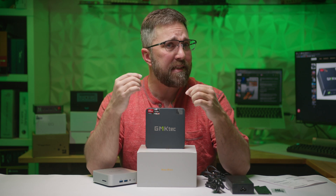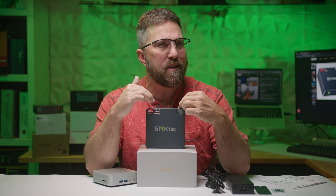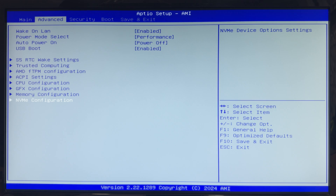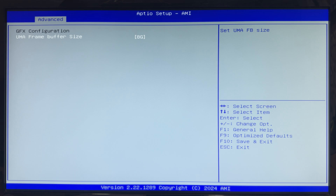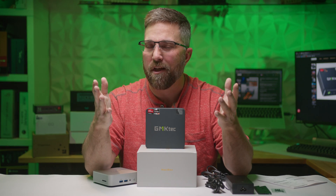If the PC has heat and fan noise problems, one way to fix it is to nerf the CPU, sacrificing performance for efficiency. Before the update, I took a minute to check the BIOS. It's pretty limited apart from setting the default power profile and designating the dedicated graphics memory — there isn't much tuning you can do here. This wasn't changed after the BIOS update.